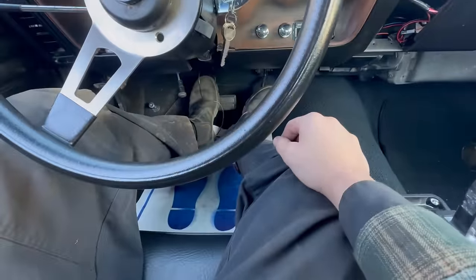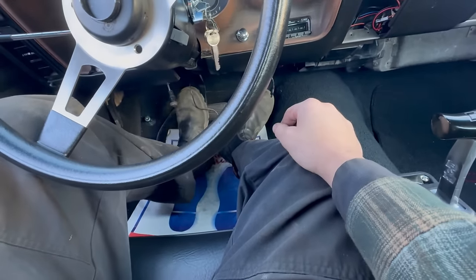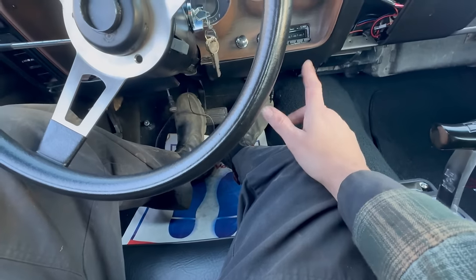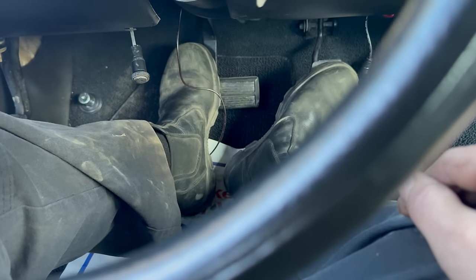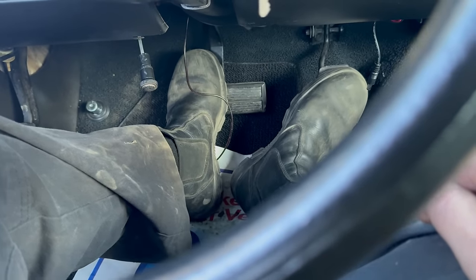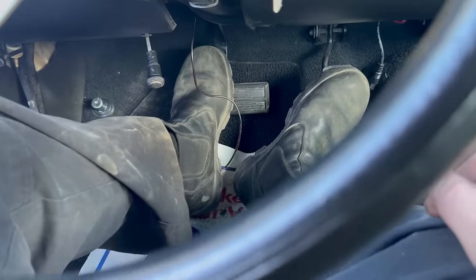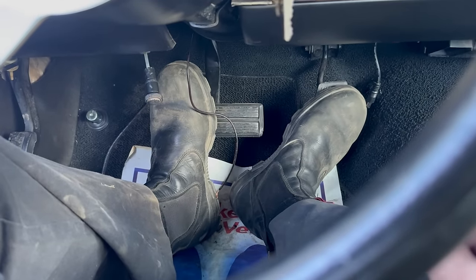Oh yeah, and as far as the brakes, better, but still not great. Good clue that your cam is too big. Hit your brake pedal and then hit the gas a bit. And if the pedal goes down because your brake booster starts doing something, yeah, you don't have enough vacuum. We may well be putting a vacuum pump on this.